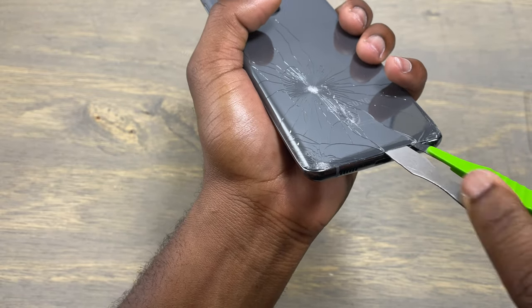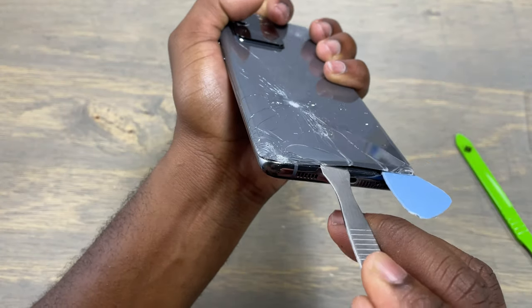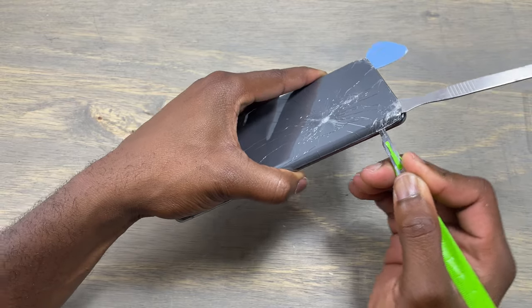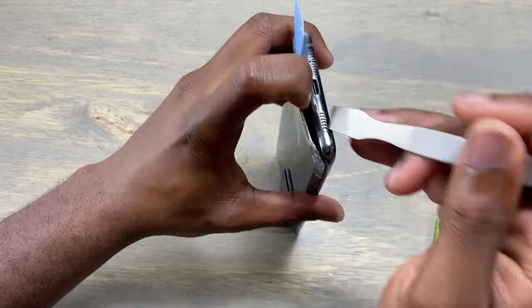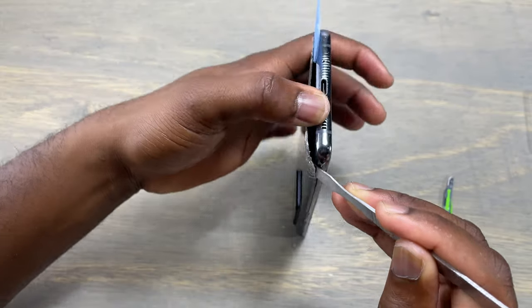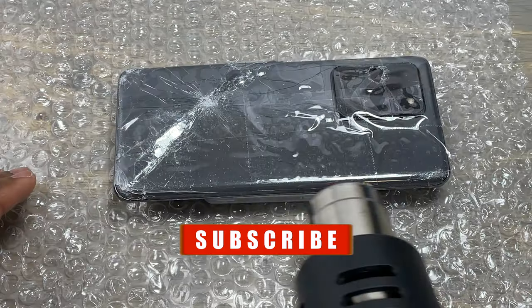Add your second tool inside the small gap that you created. You do not have to use exclusively metal tools while doing this repair — I have done it multiple times with the small plastic tools that come with the replacement kit. Use your tools to help you cut the glue around the edge of the device, similar to most of my back cover replacements; you can use the same methodology that I use in those videos.